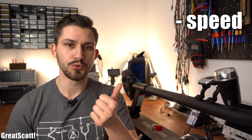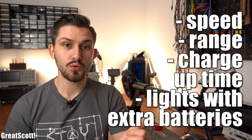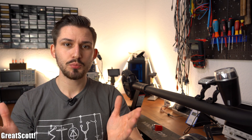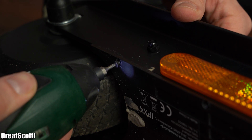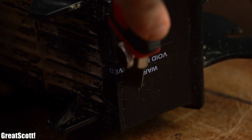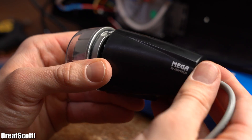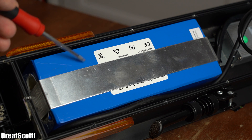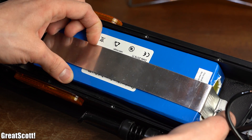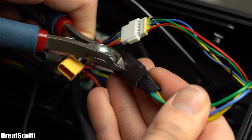Now when it comes to electrical upgrades there are basically four of them which come to mind: the scooter's maximum speed, its range, its required charge-up time, and finally the fact that the front and backlight use their own little batteries. So let's see how much we can improve those. That means it was time to remove the lid of the electronics compartment, which required removing a couple of screws and also cutting the warranty seal. Because my modifications will not only destroy the warranty of the scooter but also probably its street legal status. Removing the lid revealed the battery pack as well as the motor controller.